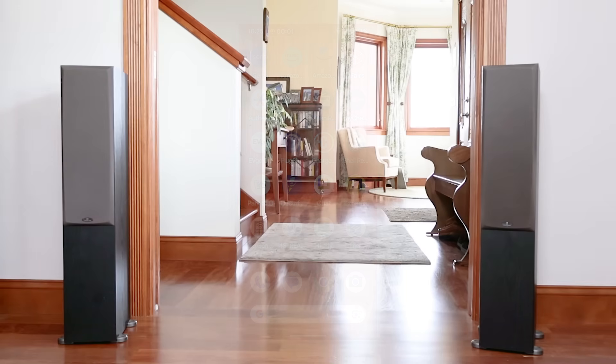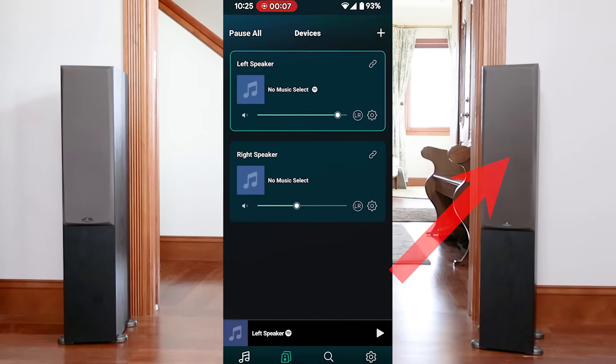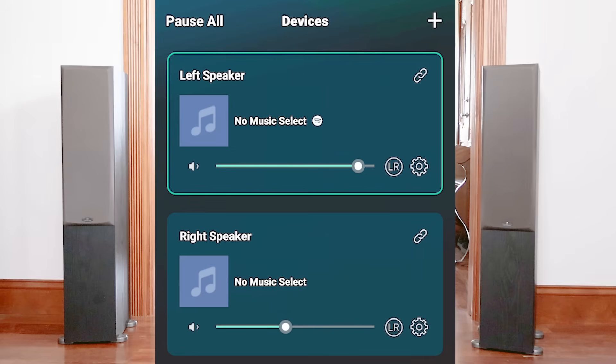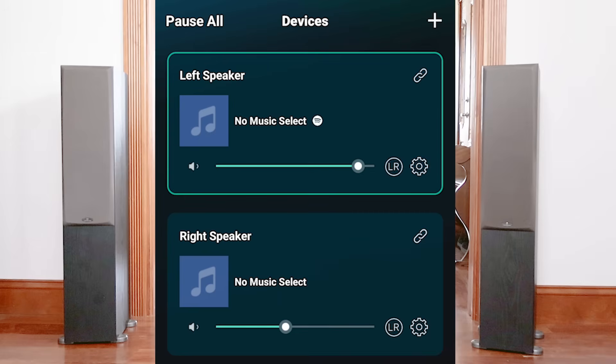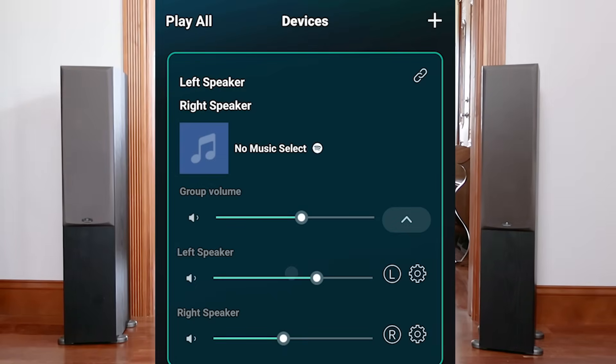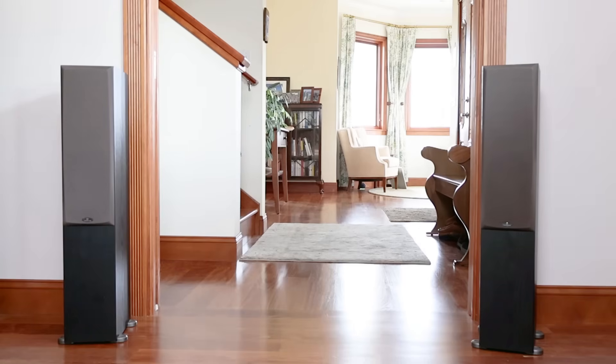Now I'll show you how to set up two speakers as a stereo pair. I named one 'right speaker' and the second one 'left speaker' in the app. To separate the two channels, go to the information box for each speaker. At the bottom right there's a little gear wheel, and to the left of that there's a small circle. Inside that circle you'll see the letters L and R, meaning both left and right channels play on that speaker. Touch the circle once and it will only display L — the speaker plays only the left channel. Touch it again and it plays only the right channel. Make sure R is in the circle for the speaker on the right side, and L for the speaker on the left. Then go back to the linking icon and link the speakers together as before. Now you can play in stereo with no wires between the speakers.